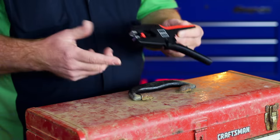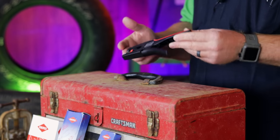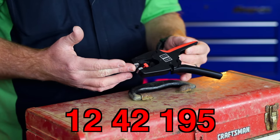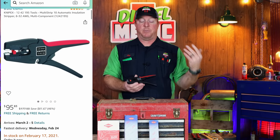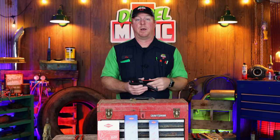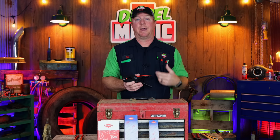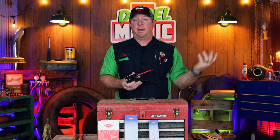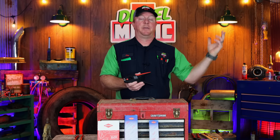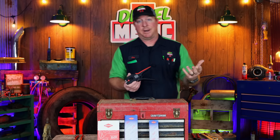The next thing I picked up is the seven and three quarter inch multi-strip auto-adjusting strippers. They go from 8 to 32 AWG. The part number is 12-42-195 and these run $95.83 off of Amazon. These things are tremendous. As those of you who've watched my channel know, I'm a huge fan of soldering and using heat shrink versus butt connectors. We do a ton of wiring jobs here — a lot of trailer lights, drivers adding lighting to the exterior of their trucks, and work for the CDL guys always tearing lights out from under their trailers. These things are going to make quick work of those wiring jobs and make life a little bit easier.